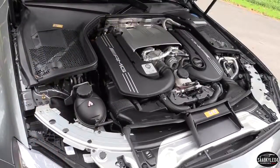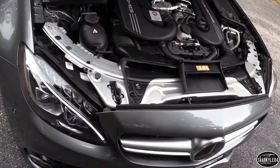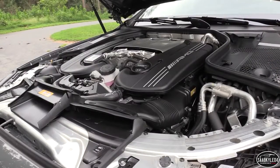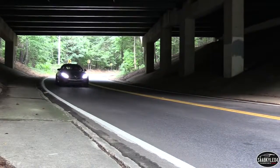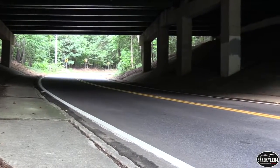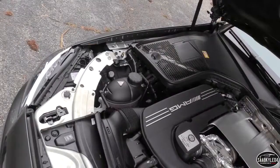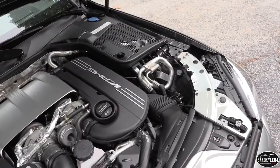With all of these advanced lightweight materials, the V8 has a dry weight of around 460 pounds. The compression ratio is rated at 10.5:1, accompanied by a maximum engine speed of 7,000 RPM. The cylinder bore surfaces are also coated by a thin layer of porous iron, a process Mercedes calls Nanoslide. The material is twice as hard as conventional cast iron liners, but weighs less and reduces friction.